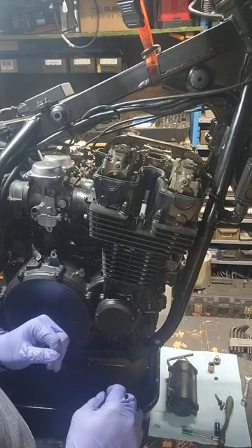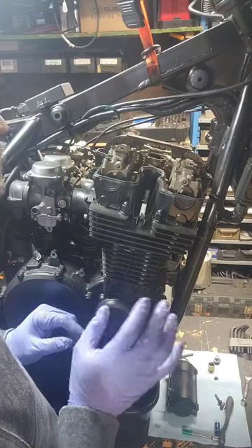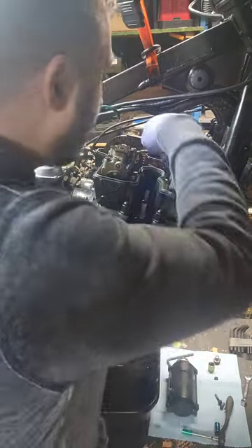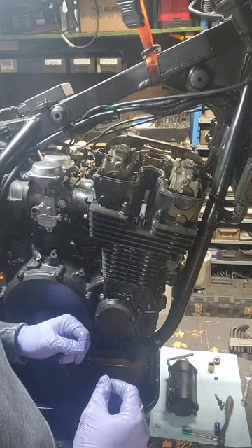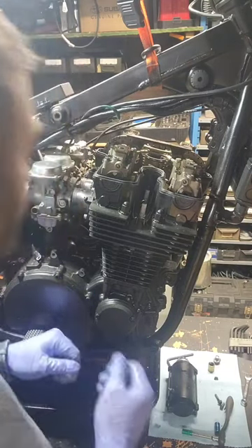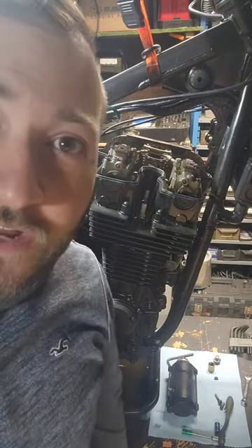This is going in a nice little process so we can make sure no parts are lost, we have proper orientation, and we can check the bolts to make sure nothing is broken, loose, or stretched. All of this is 10mm — everything was taken apart with a quarter inch ratchet. When we get in there for the actual tensioner for the chain, I'll see if I can move the camera angle a little better to show that, because it is a tricky one to get the tensioner pressed down. We'll clean up real quick with the overview of removing the coils and valve cover, getting the engine prepped for the teardown. Stay tuned, thanks for watching.